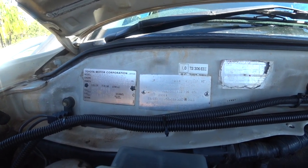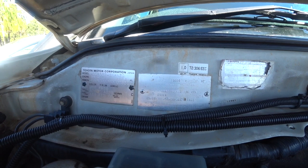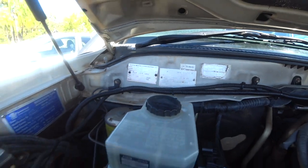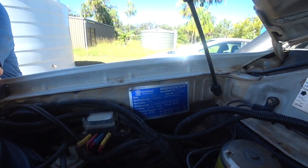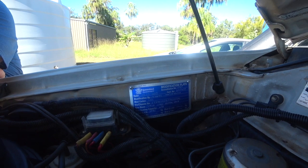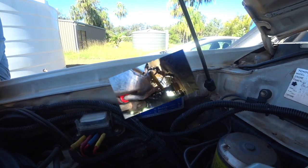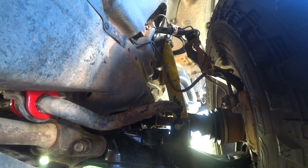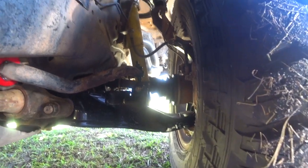The GVM upgrade did involve a bit of work as far as strengthening underneath. We had to put in a lot of new shock absorbers and things. It wasn't that they all had to be done — it was just that we wanted to make the vehicle extremely safe. We've actually got the new modified plate down there now, and we've got another 320 to 350 kilos or so. Just recently I'd already put in heavier duty shocks on the front, mainly because we were running Cooper tyres which are quite heavy. We just had new control arms done on both sides and did all the ball joints — the whole lot — because we wanted to make sure the vehicle was extremely safe.